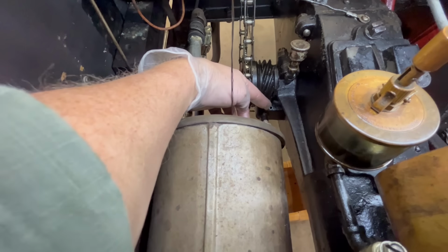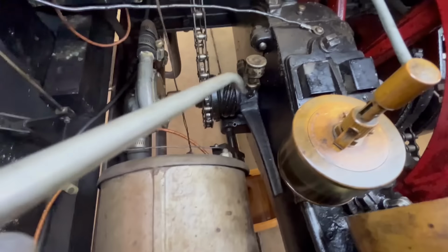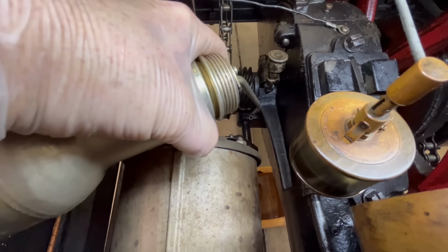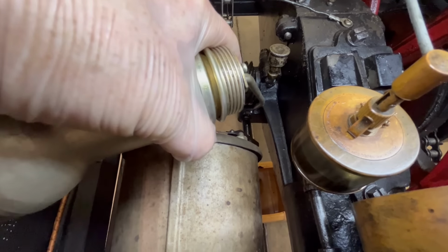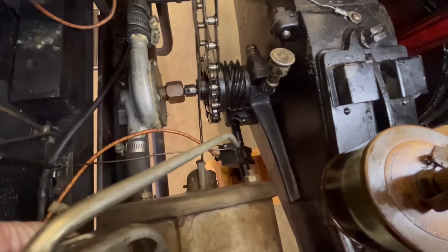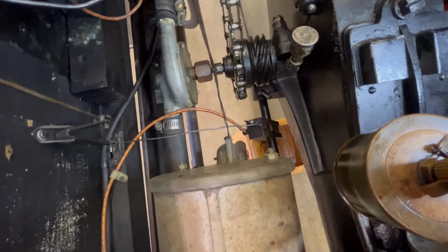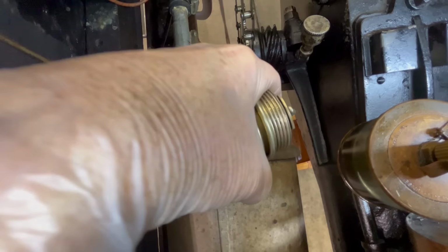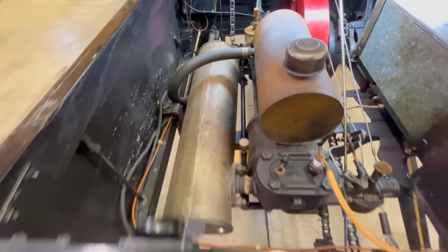However, there's a little oiler tube right down here that I need to oil. This oils the camshaft, which runs the valves, of course. Well, that'll be enough. And then if you can see it down there, that thing there is actually your distributor, which is actually a make and break contact point. And I'll put a little oil on that just for fun. Got that oiled up. And when you come back here, we've got another grease cup here for the cam bearings.